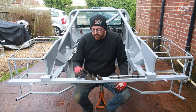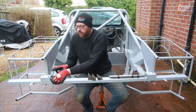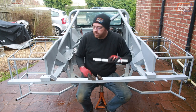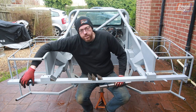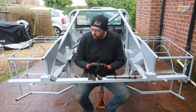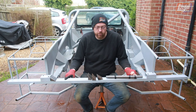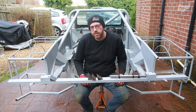Starting at the back of the car, these triangles are going to go on to these little extension brackets on the rear bumper, and this half-inch piece is going to go across the top and take these brackets which hold on to the rear lights so we can remove the bumper from the car without taking the lights off. Let's get all of this welded up, get it fitted back onto the car, and then fit these around accurately to make sure they fit right.